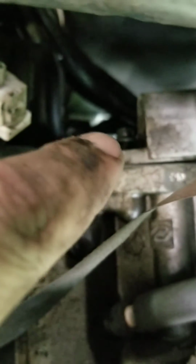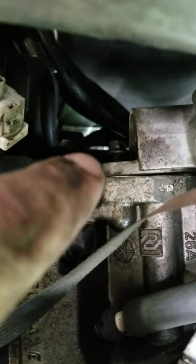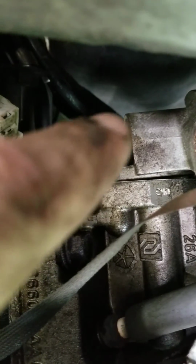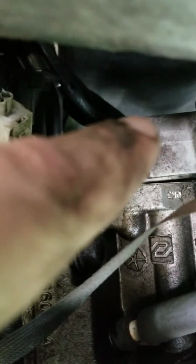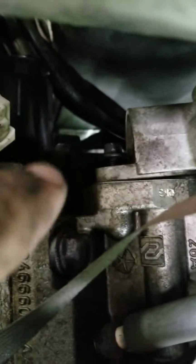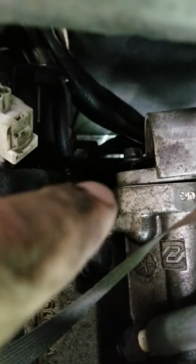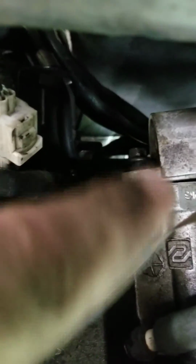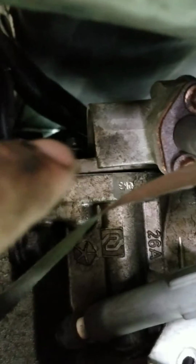And the main mount bolts that mount to the exhaust assembly are 10 millimeter. There's one on the bottom, and again, one up and behind the EGR that you can't see, but there's one back there. It's going to be a bugger to line up too. We're going to have to do it by feel, but when we pull that out, we're going to be able to pull this thing out of here and then hopefully put the new EGR back in place.